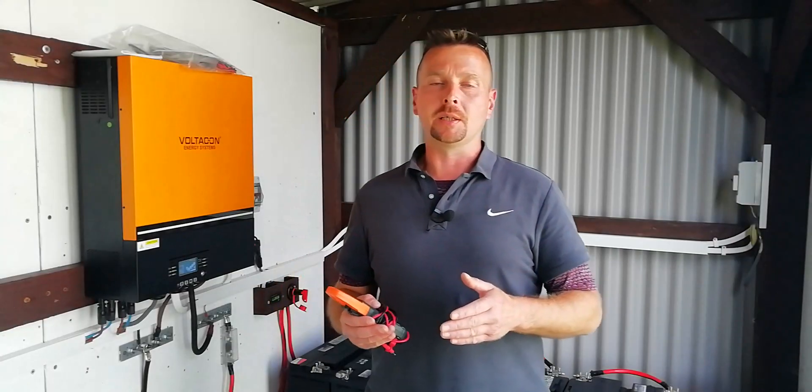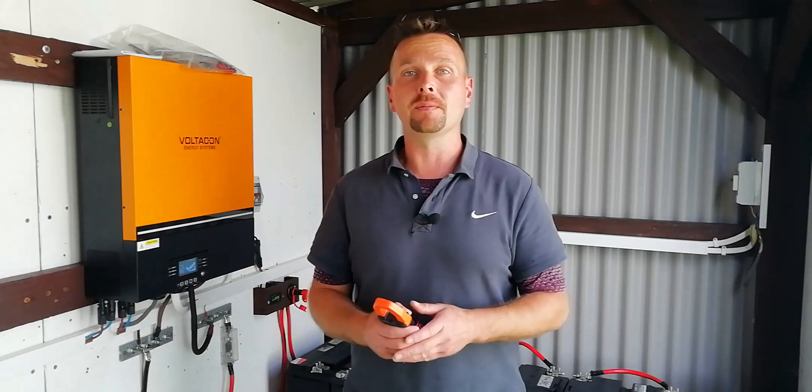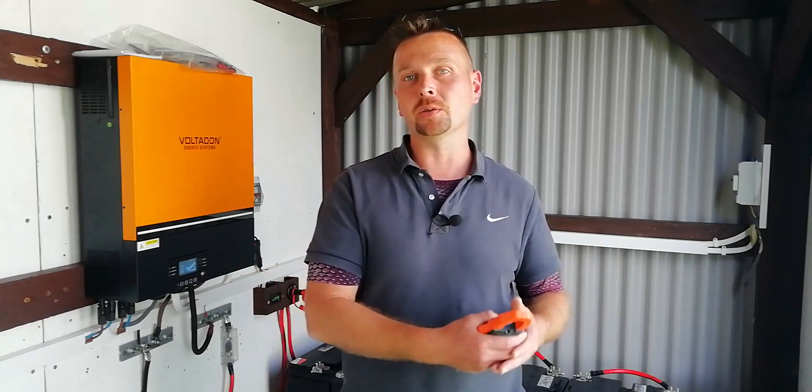Too often on social media, I'm seeing people ask what the correct way to charge their lead-acid batteries is, and the overwhelming majority of responses are simply regurgitating website rhetoric back at them. A big red flag to watch out for is anyone recommending boost cycles. Generally speaking, boost cycles are only done to try to desulfate a damaged battery which has occurred through improper charging — effectively they're recommending a solution to a problem they've created. Boost cycles are not to be confused with balancing cycles, which are done when you've got multiple batteries connected in series as part of a battery bank. As a general guide, you want between 0.2 and 0.4 of a volt higher than what most websites recommend, and you also want 50 to 70 amps available to correctly charge those batteries if they need it.